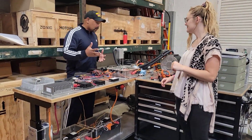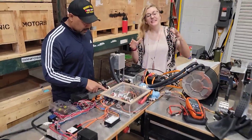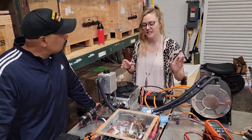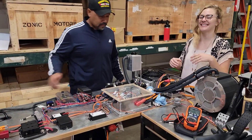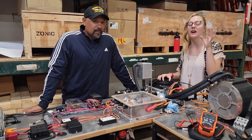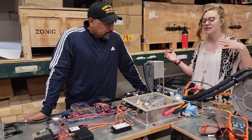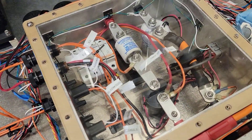Last thing I want to ask you about — I see a lot of wires and gizmos in here. What is this? What does this do? This is what we would call our high-voltage junction box, or contactor box. It has all of the more spooky components inside it that are nice and hermetically sealed. You've got your high-voltage fuses, you've got both your positive and negative contactor in there. They're labeled right now because people are going to learn by looking at wiring diagrams how this all fits together to make their EV run.